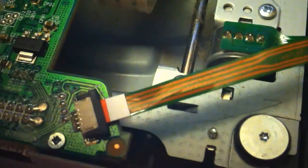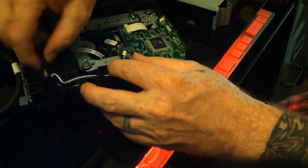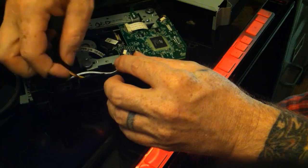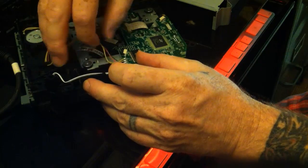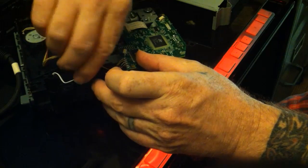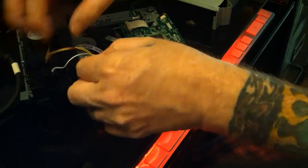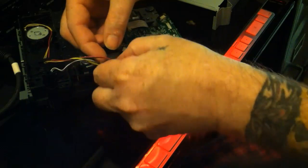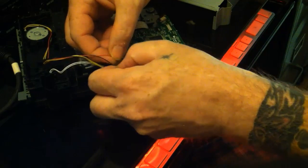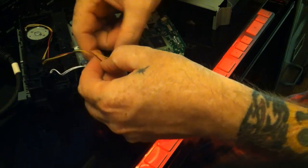Now there's the DVD drive. We're going to prepare the wires to take them off. This is the old one — you'll see I've written 'old' on the board so I can remember which one is which. Sometimes it's obvious, sometimes it's not — sometimes you can get mixed up. The best thing to do is mark your work. I'm just gently getting the wires ready to be removed from the board using a soldering iron, which should be 15 to 30 watt.